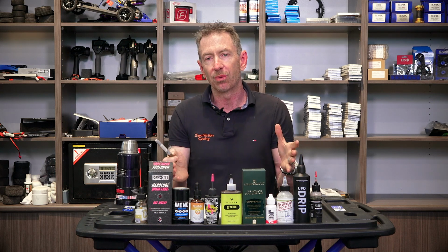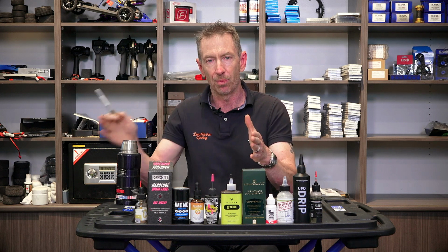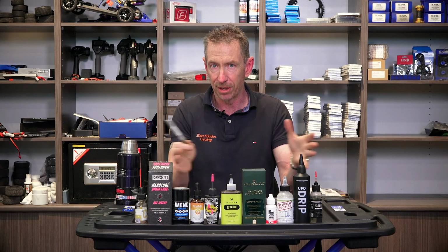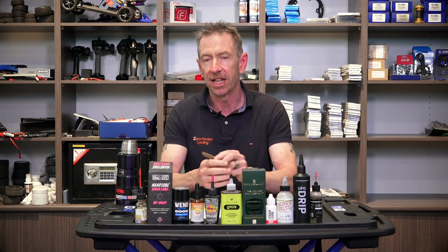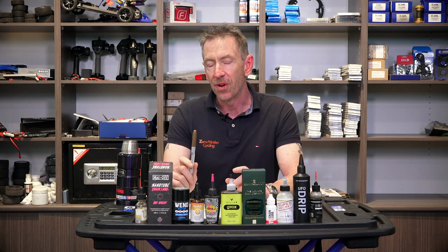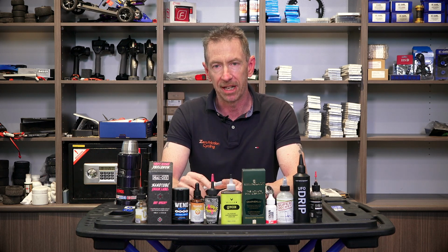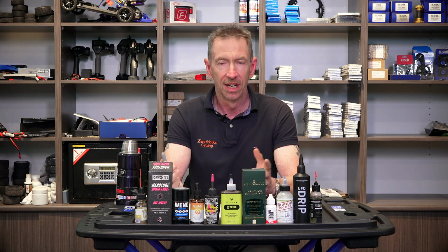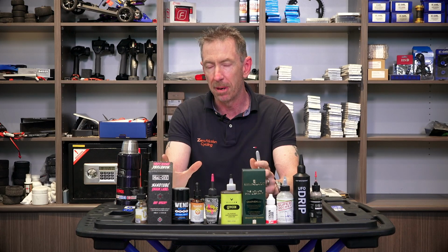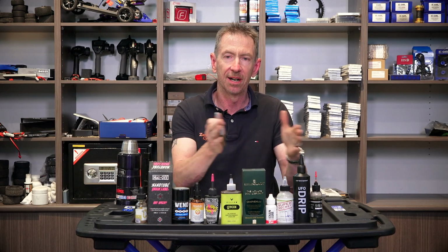Because we're going to have 15 to 20 lubricants in pretty much the top 1 to 1.5 watts. And then pretty much every 1 watt thereafter, you're going to find another grouping of about 15 to 20 lubricants. Things are pretty tight. There are hundreds of lubricants out there, and they're all falling in these particular ranges. Now, if you're testing via power meter, even a very, very good power meter has a plus or minus accuracy of 1%. So at 250 watts load, that's 2.5 watts each way, a 5 watt ballpark. That's a pretty big ballpark to try to then put into a league table of which lubricants are more or less efficient.